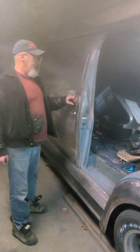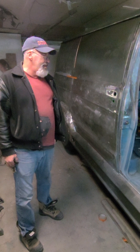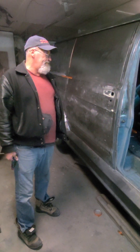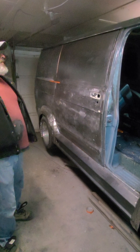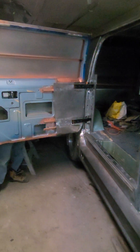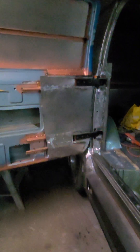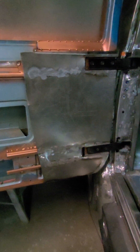So here we are back at the ranch — the door is fitted. A major accomplishment today: the door is hung, and it's a suicide-style opening. Open the door — there you go — with a whole bunch of reinforcement. Look at that, it almost opens to 90 degrees. This is all extra stuff; these are 18-gauge pieces that went on top of and around the hinge because the inner door wasn't strong enough.